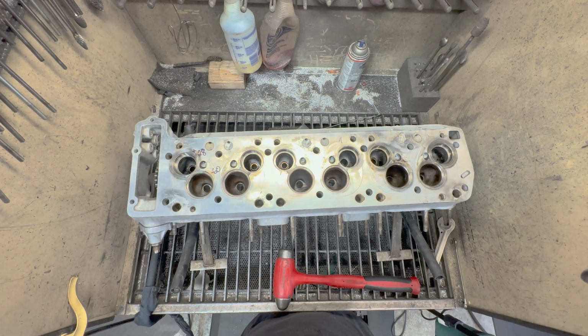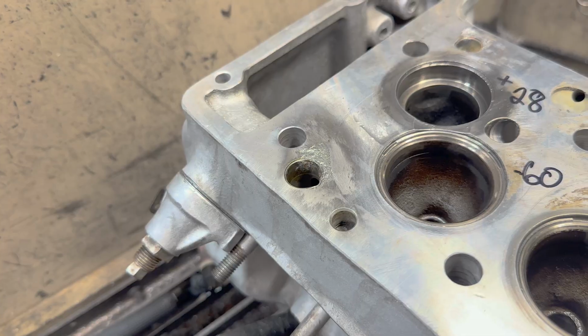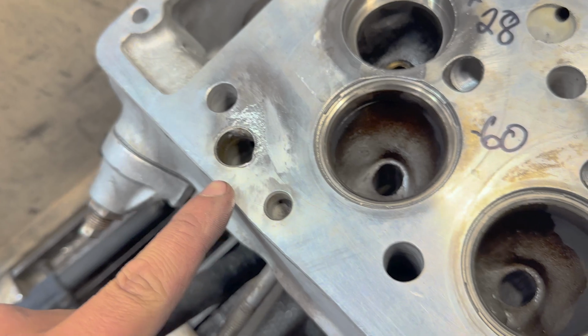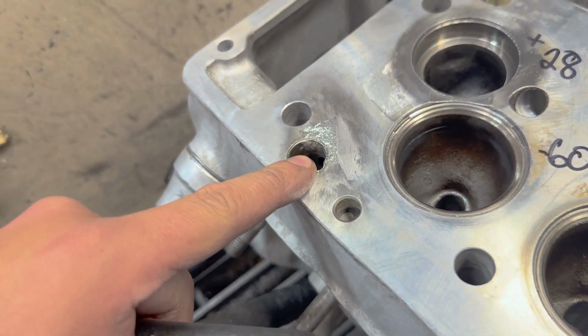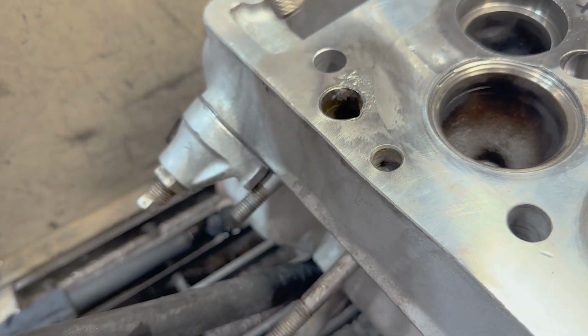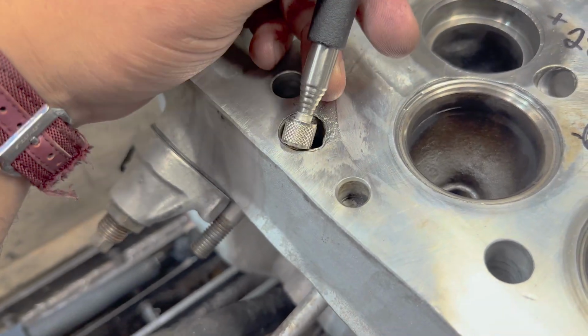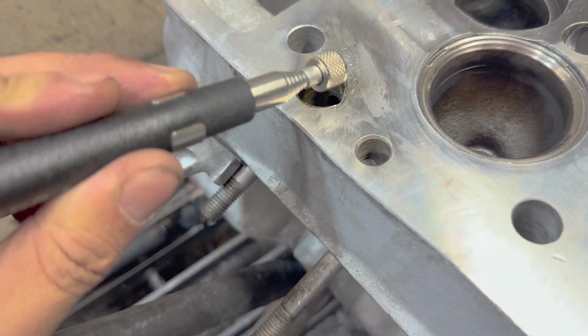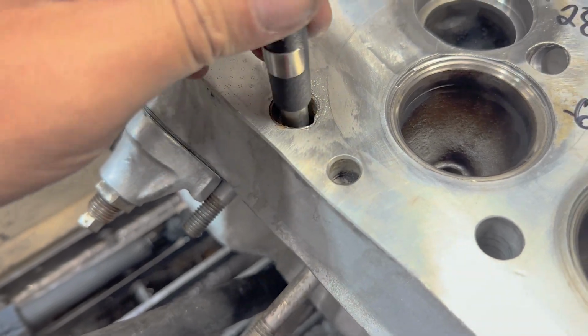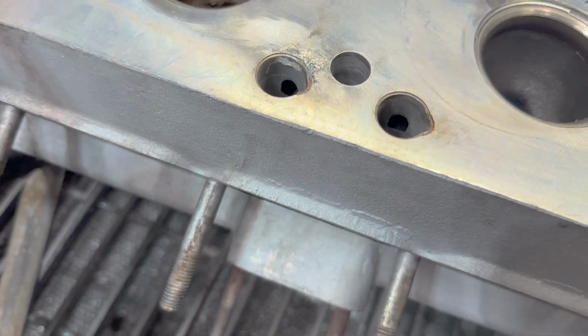Okay, let's try to get this thing prepped for welding. So I file tested these inserts. They feel pretty hard. Drug a knife across it. Again, feels pretty hard. They're magnetic as well. Tin is not magnetic. I think these are steel or stainless steel.